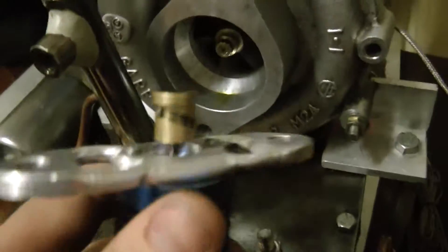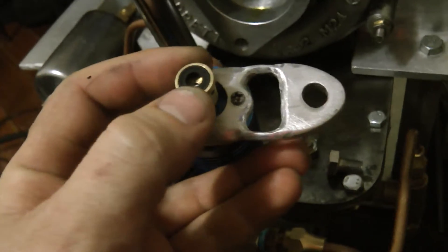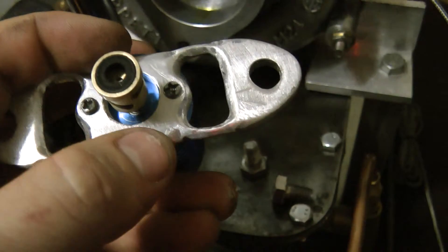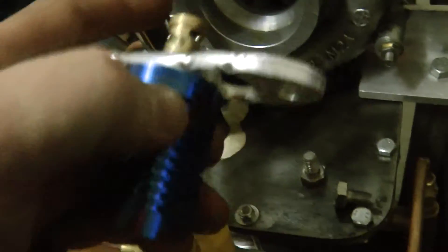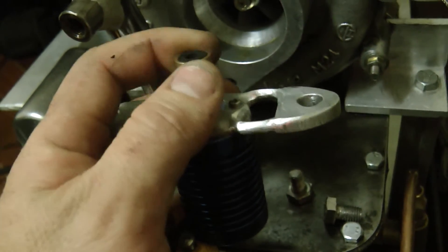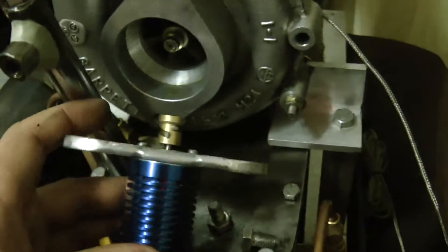In this video I'll explain how to mount your Bendix clutch. When you mount it, especially if you upgrade the rubbers — which I suggest you do — if your end's not sticking out much, don't worry about getting a hole in the centre. When you mount it, you want to mount it fairly close to the nut, as close as you can without it interfering. Otherwise you'll get all sorts of vibration. So that's how you mount your Bendix starter.